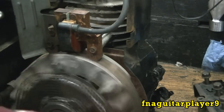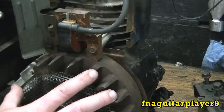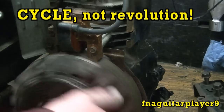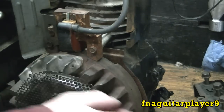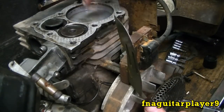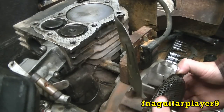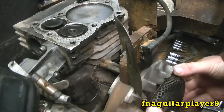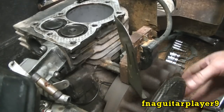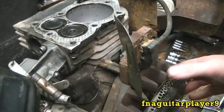That's why it fires on every stroke of the engine — there are no other switches or anything controlling it. If the flywheel were running off the camshaft at half the speed, it would only fire every other revolution, but it runs off the crankshaft, so it's in direct timing with the piston and valves. Right now you can see the magnets and the piston — the piston is coming up and it's going to fire. It actually fires a few degrees before top dead center because of the spark advance. Right here is the actual power stroke where the piston fires.